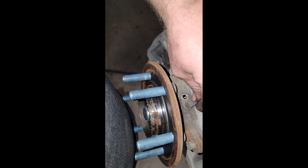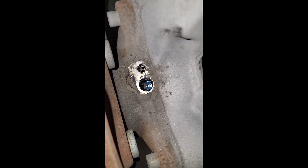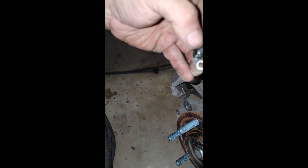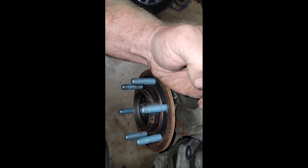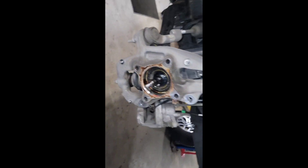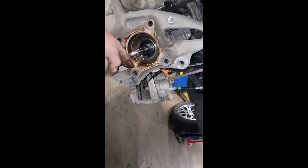I went ahead and took the passenger side off just so we can compare. See how that's nice and blue inside there? The other wheel bearing is damaged. That one is nice and flat — it doesn't have any step in it at all. This one over here has got water inside it — it got all milky and it chewed up the end of the sensor. It's got a step on it where it's been riding and digging inside that sensor, and that's all damaged. The hub actuator itself is good — no water contamination, all the teeth are good, nice and clean. I'll clean that up and re-grease it. So I need a wheel bearing and I need a sensor.